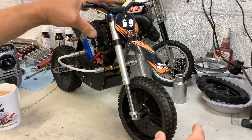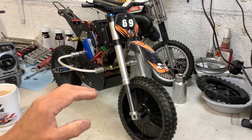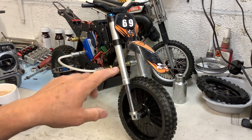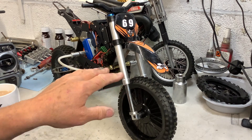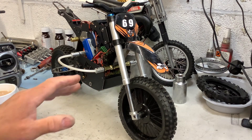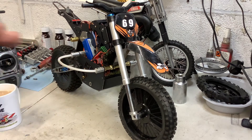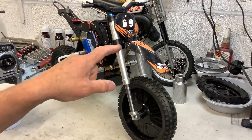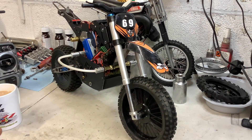I've not had to touch it. Before, without the anti-wheelie, these forks are not very strong — you can bend them. I was forever straightening forks out and stuff like that. It wasn't that the bike wasn't strong, but you've got a heavy bike here and when it came down on the front there's a lot of leverage — it would bend the forks. But since I've put the anti-wheelie on, I've not had any trouble whatsoever.